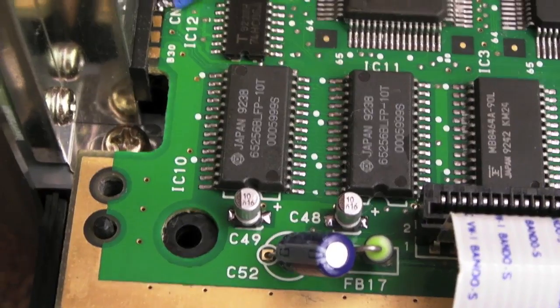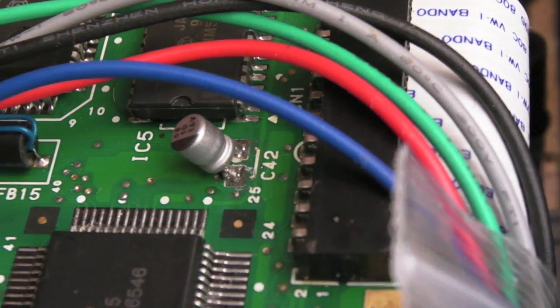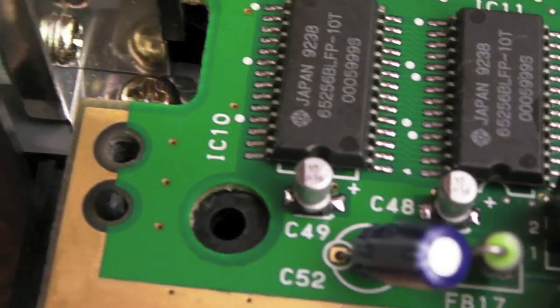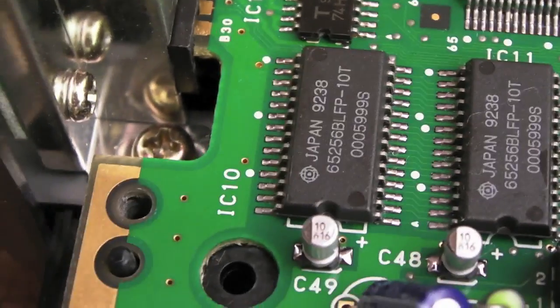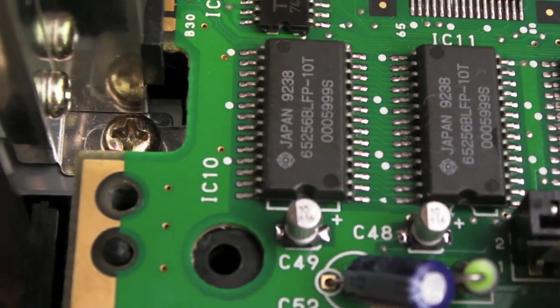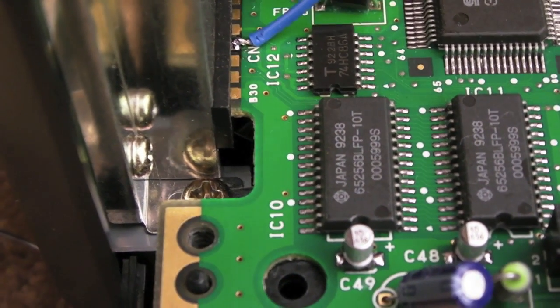Here's a quick progress update — you can see a couple I've just done. The board's not super clean but compared to that rickety temporary mounting, the new ones look much better. Look at these ones down here — you can see where I didn't clean the flux off and didn't clean the corrosion enough; they look awful. This was long overdue. With a bit of patience and good flux you can do a reasonable job. The alignment isn't perfectly straight on one but the flux makes the big difference — this Chip Quik flux is just the ticket.